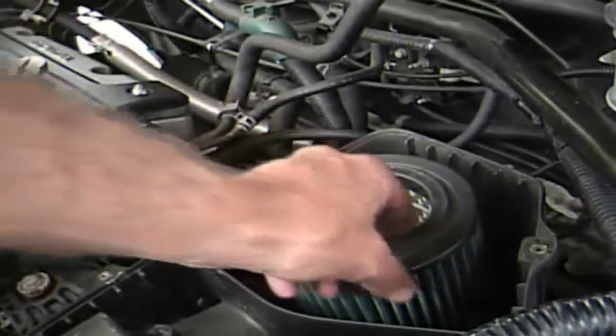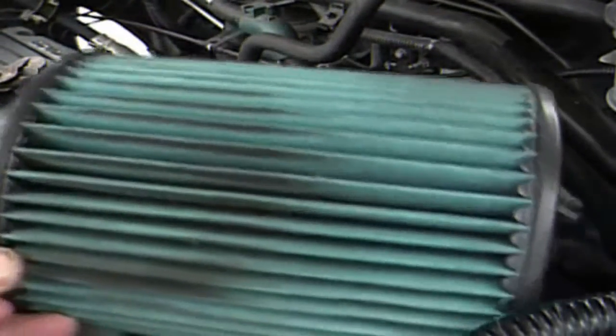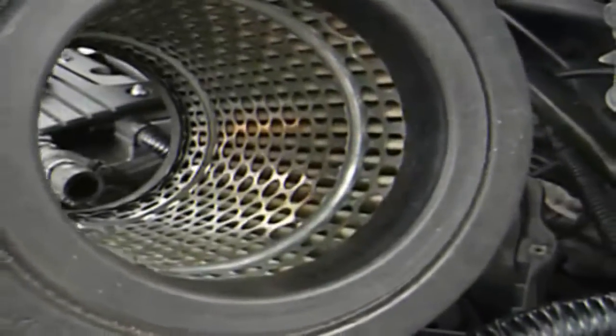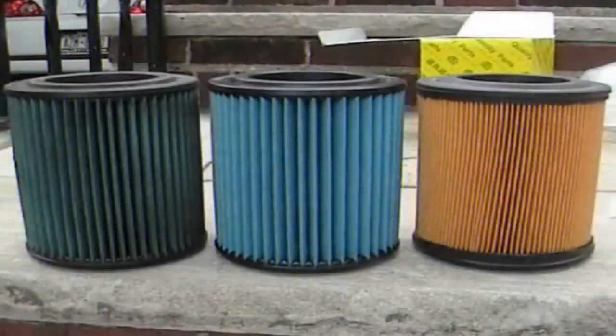Exposing a blue genuine Honda filter that sells for roughly $18. Notice how it gets dirty in one spot — you can capture just about anything that goes in there. Believe it or not, even though some parts look clean, it is best to replace the whole thing. Leaves can get in there. You have one filter that goes into the oil and the other that goes into the air — you want to make sure both are nice and clean.